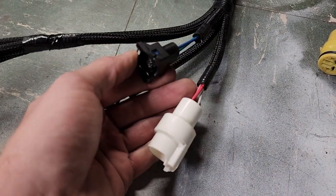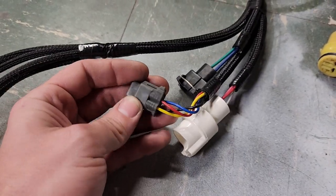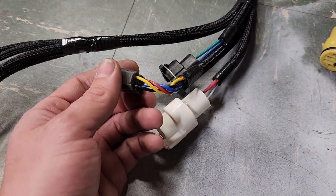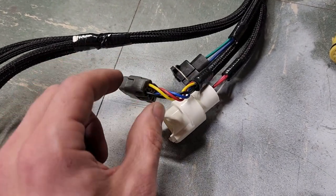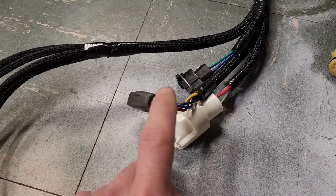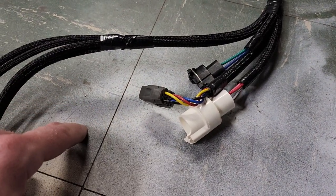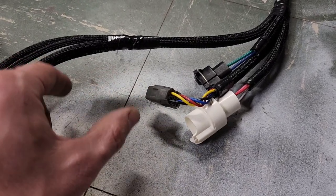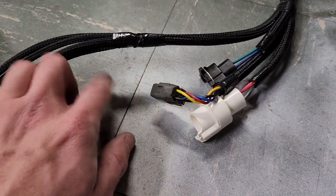The next connector is the cam position sensor — four pin. This is technically both a cam and crank sensor. You'll see information out there saying the wire colors don't match, and that refers to the harness on the CPS itself, not the engine harness. All manuals cover the engine harness side. That little internal harness is part of the CPS assembly, so you won't find specific documentation for it.